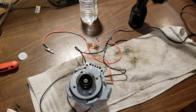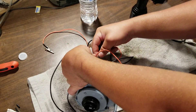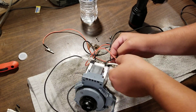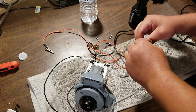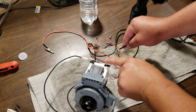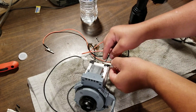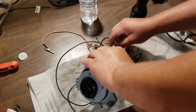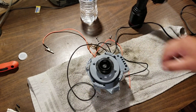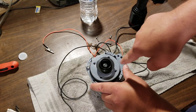I kind of dug into this pump. As you can see, I already removed the screws. I'll power it up in a minute — it's something so simple, but yet it causes a big headache for users. I'm going to reconnect this wire back on and reconnect this wire back on. I'm just using simple alligator clips. You should also tape off these two points here because on the circuit board, this is right where the windings go in — the windings are soldered onto this control board. And we'll turn it on. As you can see, that thing is just jumping all over the place.